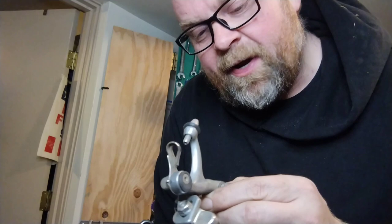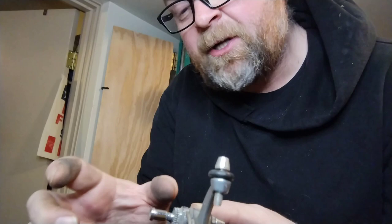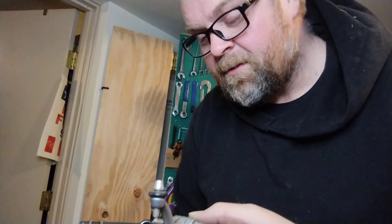There are some tricks you can do, like we did on the Univega and some other bikes, where you can mismatch brakes. Let's say I really want to run these vintage sprint brakes — I can only find two fronts. I can run a front on the rear and just use a regular nut, get rid of this recessed nut. You can also get these little recessed nuts in a bunch of different lengths, so I can use this rear on the front with a great big long nut, and use the front on the rear because it's much longer — the threads will poke all the way through and I can use a regular nut on it. So there are tricks.